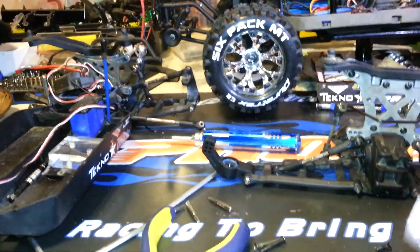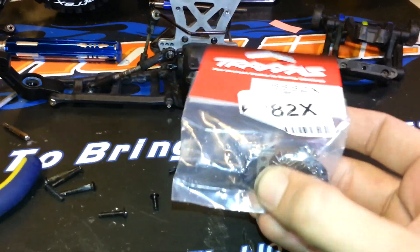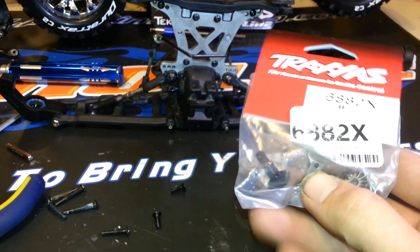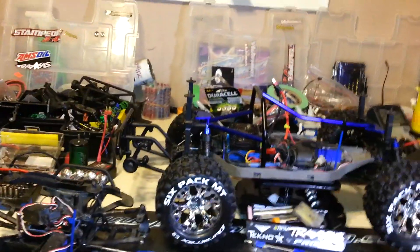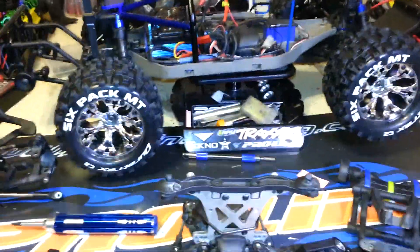Today I'm going to install the X01 Rebuild Kit. It's actually for a bunch of different trucks, and it comes with the i-bar which is not stock. This whole gear set works great for the Stampede or the Slash — 4x4 — it's basically a Revo diff.